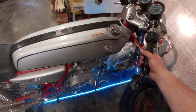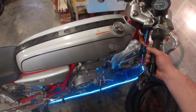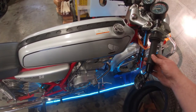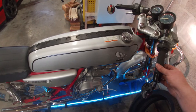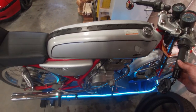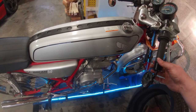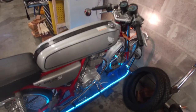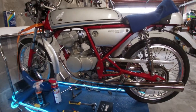So it still has this issue — it's down at idle and now it doesn't do it, but if you push the throttle too hard it drops. If you slowly raise the throttle it goes all the way up — sounds pretty nice. It also idles a bit rough and you can see the headlight is flickering. So the carb is clean but it still has the stuttering at low RPM when you open the throttle.